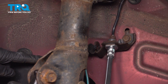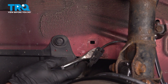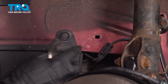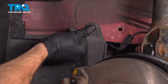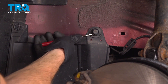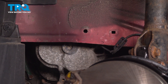Now we can follow that along the front area of the strut to where it connects onto the body. For this, we'll just use a small prying device — I'll use a trim tool. Get right in between here and gently pry it out of place. Now we will follow this up and behind here. If you can't reach up behind here, you can remove this push clip. To remove a push clip, just get right underneath the center and pull that out of place. With it in the unlocked position, continue onto the outer aspect and just pry that out of place.